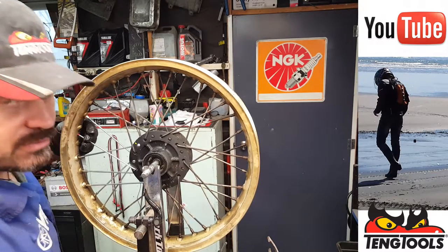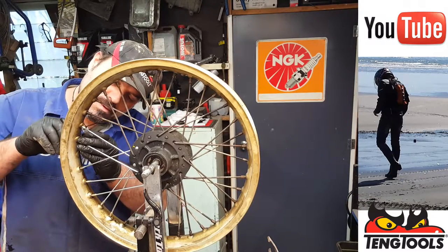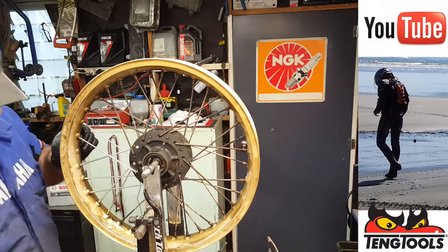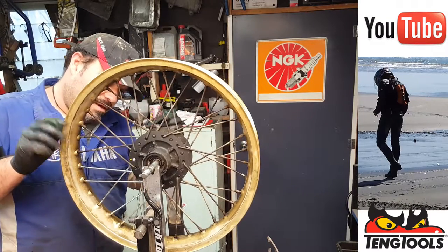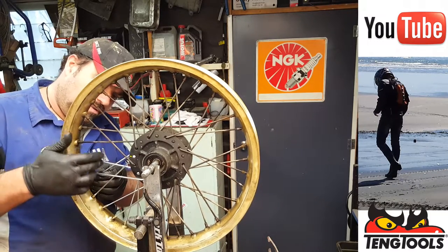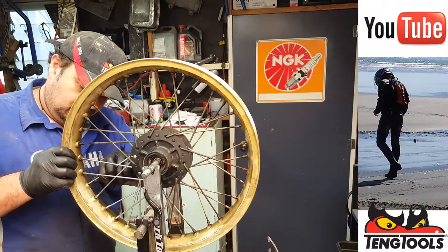We're going to have to do in batches of four on this particular rim. Last one, another white, and that's here. That goes in from the back, comes around, goes over the top of that spoke, just like that one did the outer spokes, and it goes into there.